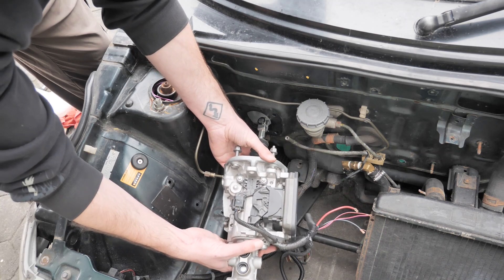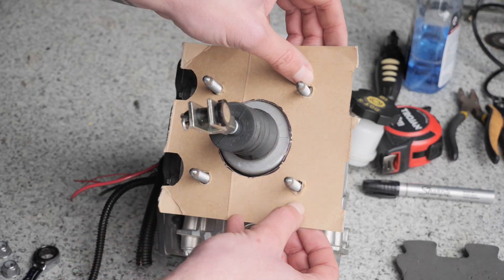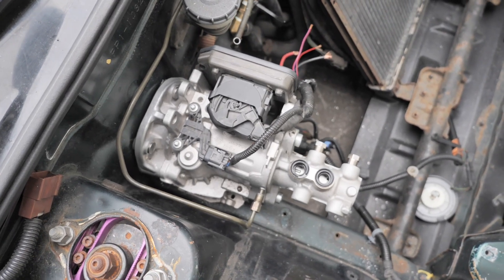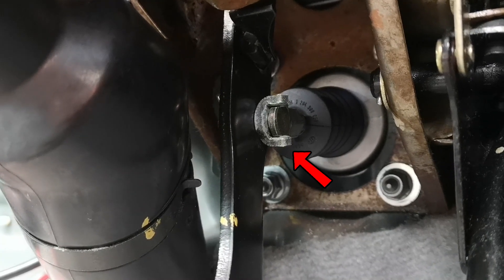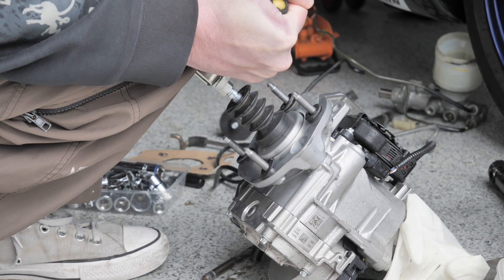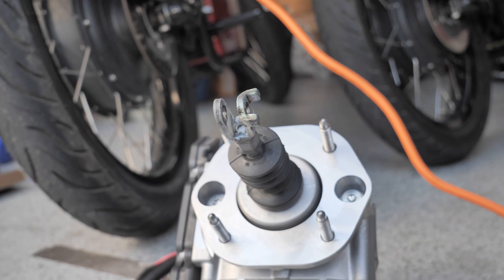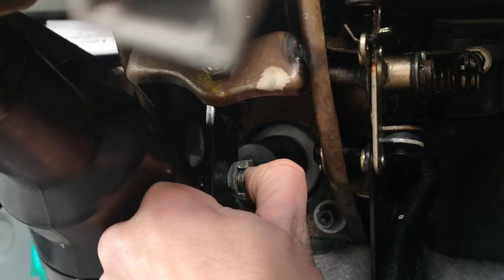Here's a test fit to see how it looks in the car. This is going to work. The only difference is the iBooster bolts are slightly wider, so I made a template and traced that onto the car to drill new holes for it. I would have never thought a brake booster out of a Tesla would fit so well on a Beat, but here it is, like it was meant to be. I'm not changing the Beat's brake pedal so I wanted to use the same bracket — this fork thing. I figured I could just screw it off the original booster and screw it onto the new one. But for some crazy reason, the iBooster's fork is welded on. So shout out to Miramar Fabrication for fixing my mistake — they welded the Beat fork onto the iBooster and now it's even stronger than the original one was, and it connects exactly how it used to with the original bolt.